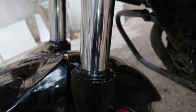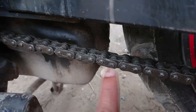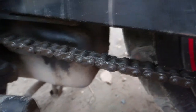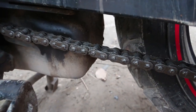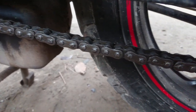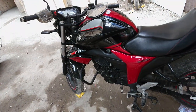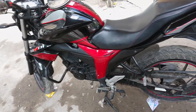If the rod gets damaged it will cut your oil seal, leaving you only one option: to replace the complete rod. Chains are very hard to maintain in the rainy season — even after lubing, they still rust quickly. What I've done is apply grease on the side walls and spray lube on the inner side. After a month of observation, rusting was reduced by 85 percent.